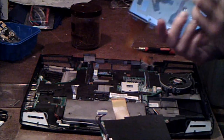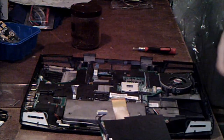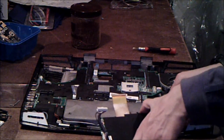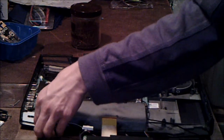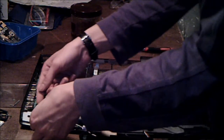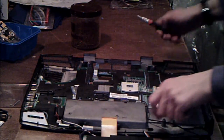You should be able to take out your disk drive just like that. It's a slot-loading disk drive — this one is not Blu-Ray, it's just a regular DVD burner, CD, etc. Now the speaker assembly should be able to come right out.